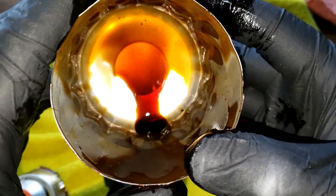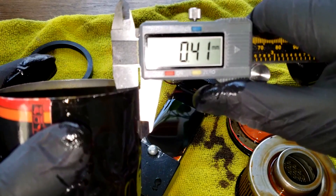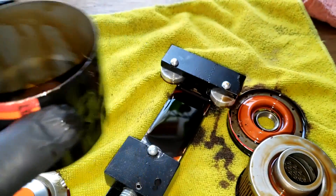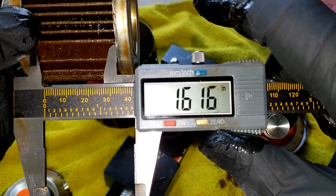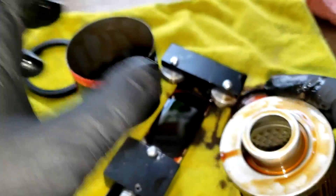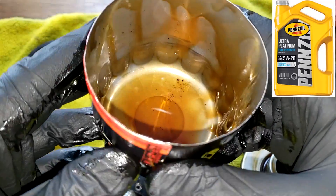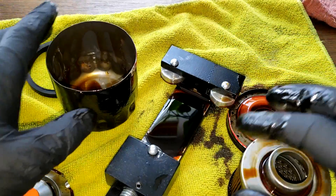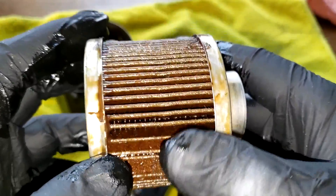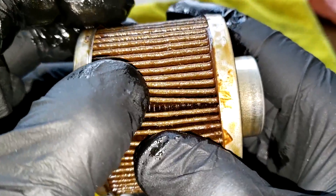How about the can? The oil looks nice — no sludging. Let's get some measurements. The can wall is 0.41 millimeters thick — not bad. The filter element width is 1.61 inches wide. And Duane's using Pennzoil Ultra Platinum 5W-20. We'll also cut the filter media open, stretch it out, and see how long it is. We'll also take a look at the oil report for this oil change.